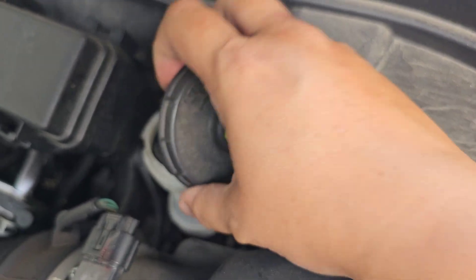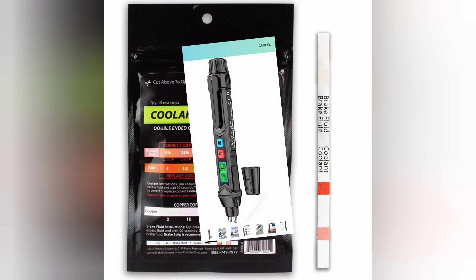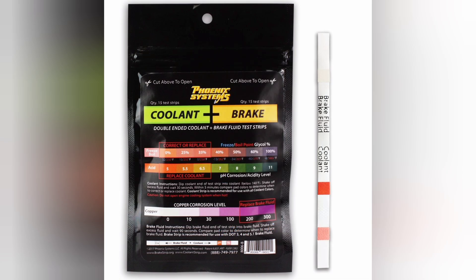So as you can see, the Honda Pilot definitely needs a brake fluid replacement. I also used a digital tester to test the moisture level, which came back good, but it did not pick up the corrosion levels that the test strips did. So the Honda Pilot is definitely due for a replacement — otherwise I would not have known. If you want to check these out, there's a link in the description. It's definitely helpful if you have no history of maintenance on a car, and it's a great tool when you're out buying cars. Thanks for watching!